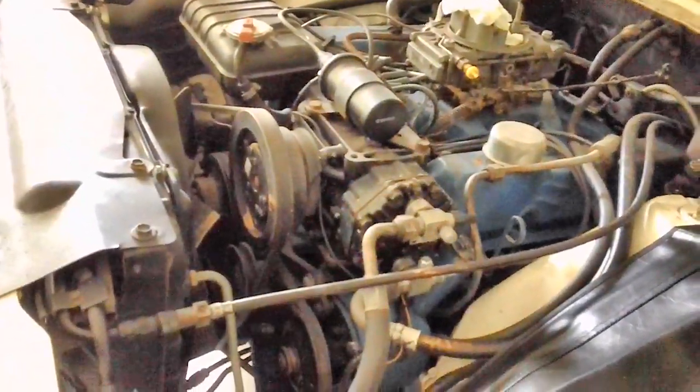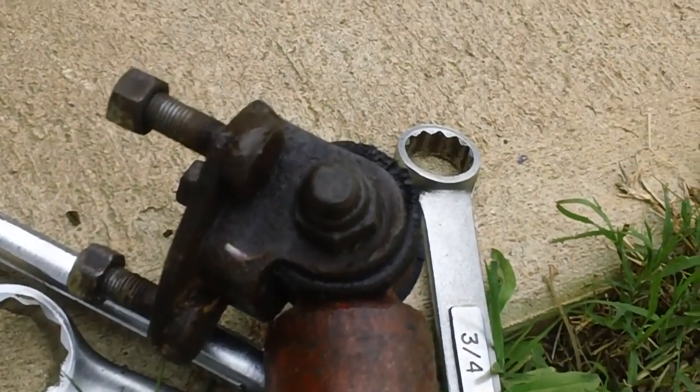That's what's going on so far — it'll be a few days before I get back to this car. I have things to do around the house, and Saturday a friend and I are going to a flea market about 20 miles away. The coil spring removal won't be that difficult, but I'd really like to know if a 1967 coil spring would fit in this 1966 Thunderbird and give the same ride height. I've hunted high and low for '67 T-Bird ride height specs and can't find them anywhere. This spring has eight coils.